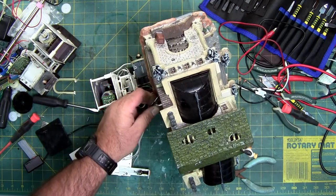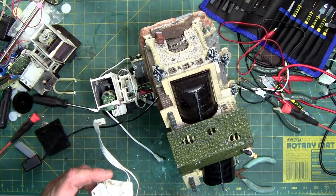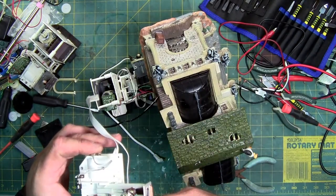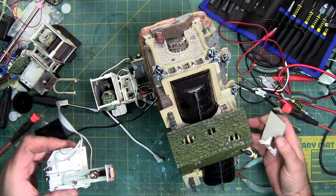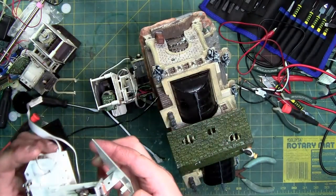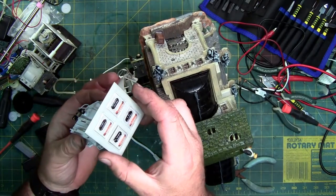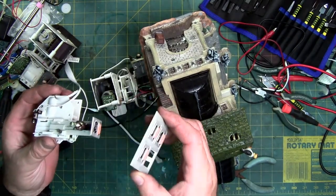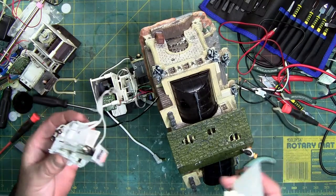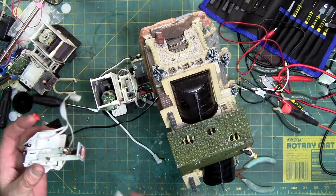This is held on with a single screw right here, and it's got two alignment tabs that press against the plastic to keep it square. This is not glued to the front of the porcelain. This is the tricky part — this door fits in this hole, it just doesn't look like it. You've got to finagle it and go sideways, and then voila — there's your door. It's a lot harder to do when it's inside this indentation. It's easy when it's sitting in your hand, but it is really difficult. Take your time; be patient.